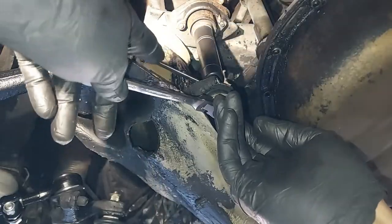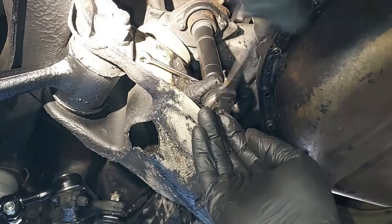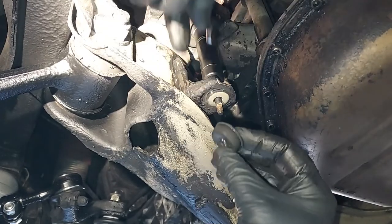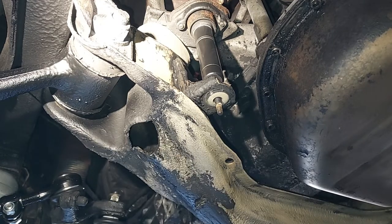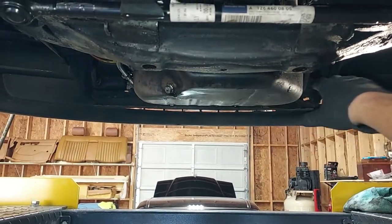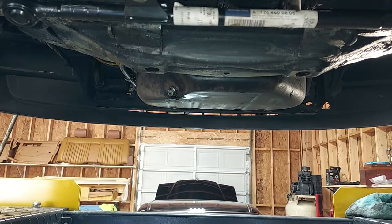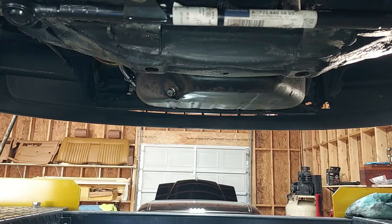And see, a little wrench just presses up against the frame there and holds that. There we go. And again, that bushing is in excellent condition. Nothing wrong with it. All right. Now that we've got those loosened, we can put a board under the engine, or under here, and jack it up just a little bit. So let me open the hood, because we want to make sure that when we jack up the engine, the fan doesn't contact the radiator shroud.